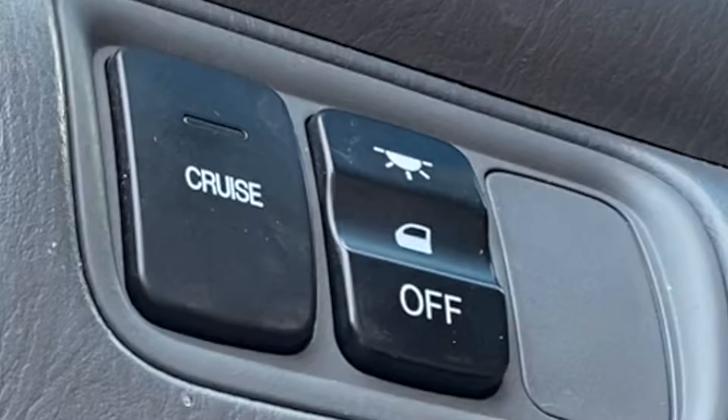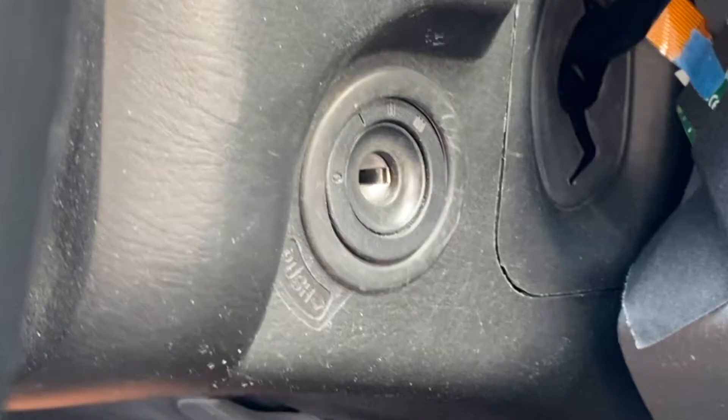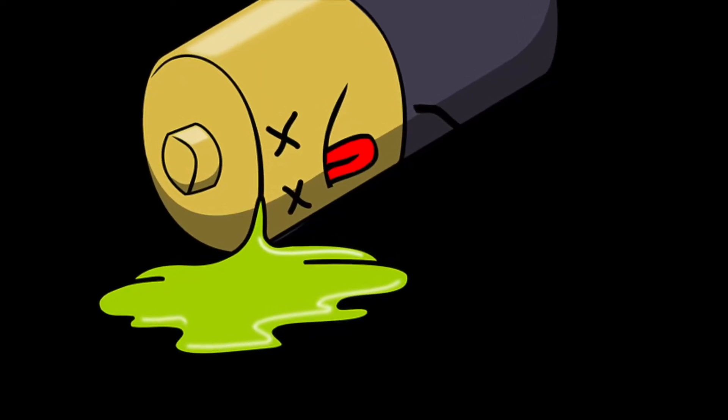These lights can have four modes: they can be fully off all the time, they can be in door mode where when the doors open they turn on, they can be fully on all the time, or they can be individually switched by that switch in the handle. And the problem with this individually switched mode is it works regardless of whether or not the car is on or the key is in the ignition.